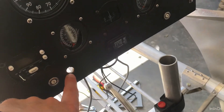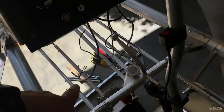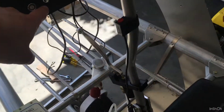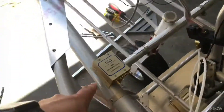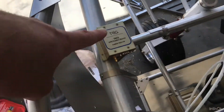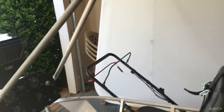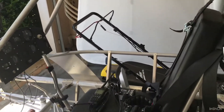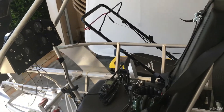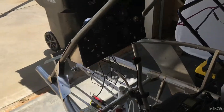I've got one more circuit breaker coming — a one-amp circuit breaker. The three-amp is working with the transponder, and the one-amp is going to be for another part of the system — I think it's actually the TN72 GPS position source, because that's independently powered from the battery. Later I'll show you the wiring diagram. It's not going to be hard, but you've got to be really meticulous about where those pins go — you don't want to reverse ground and power on this thing or you'll fry the system, according to the manual.